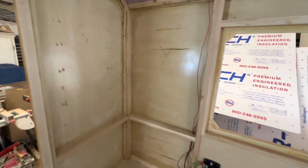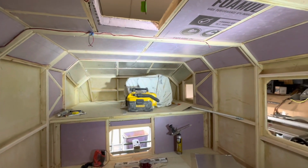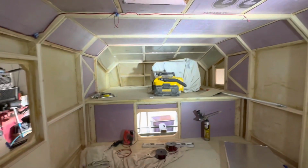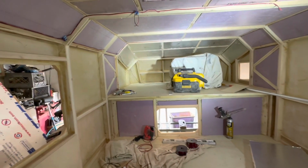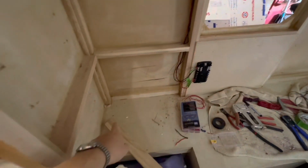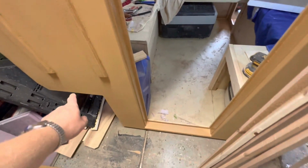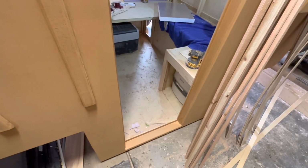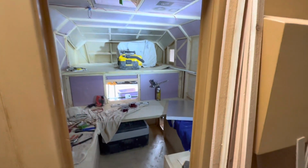There's a lot more I've got to do in the electrical system. I also will set up the running lights and the brake lights back here in the rear. And as I talked about in the last review video, I'll run the wiring so we can tie it into the backup camera. That will be a whole separate circuit from the wiring I'm working on now, but it will come down there and pop through the bottom, and then when this is on the truck, I'll be able to plug it into the trailer, the little 4-pin electrical plug there.